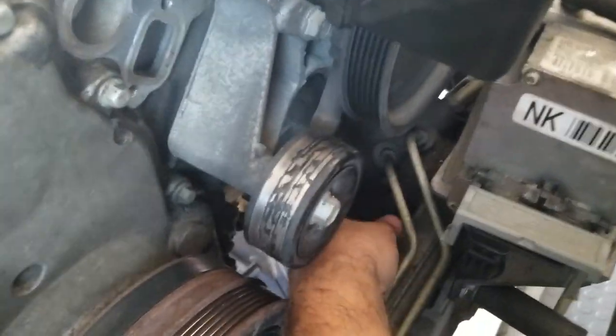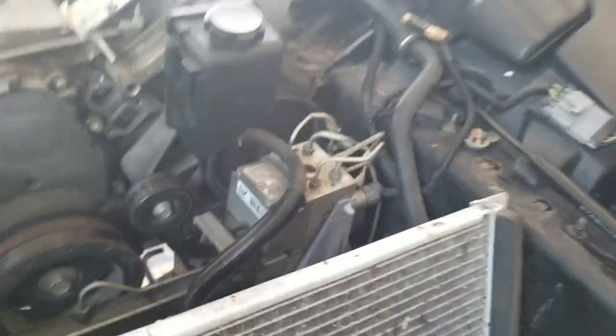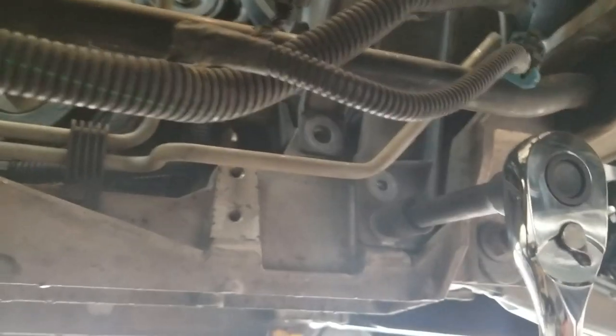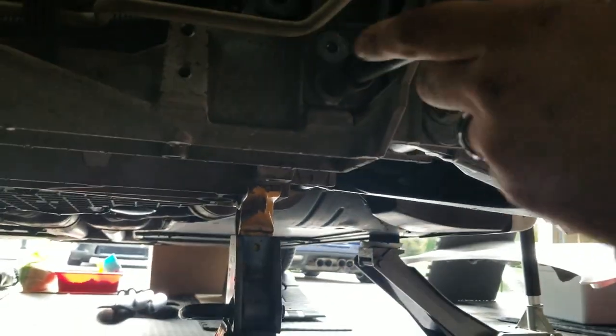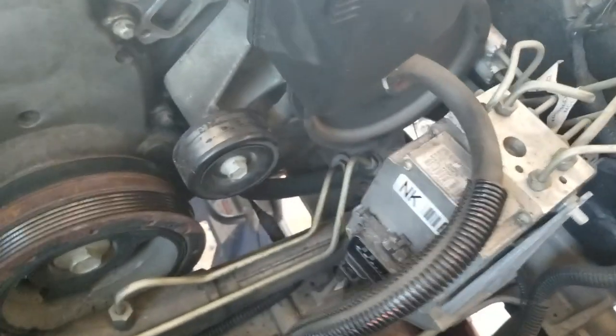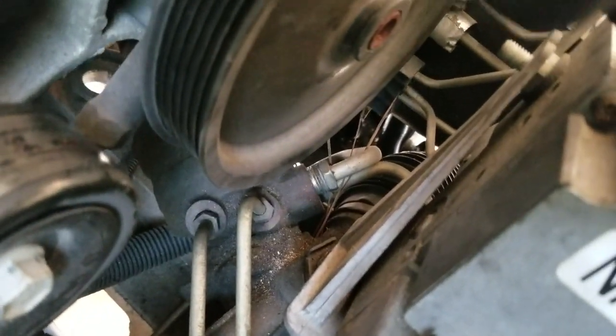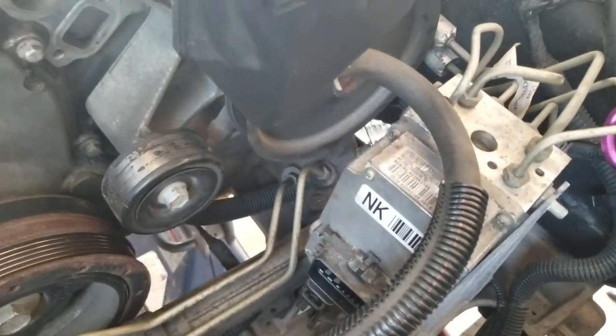As you can see, there's a bolt down there attached to the nut — I've already loosened it. You need two 18mm: a wrench in the back and a socket up front. There are a couple more bolts down there I have to remove to move the ABS controller out of the way. The easiest access point is from underneath the car. I already got the top point removed with just a 13mm. I moved the module out of the way a bit and was able to reach the top one, which I'm unscrewing now with an 18mm wrench, pushing it out of the way by hand.